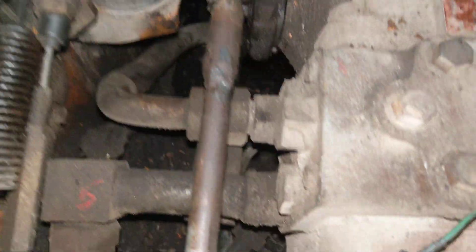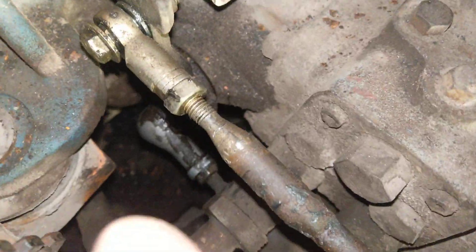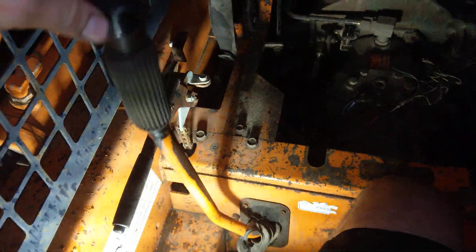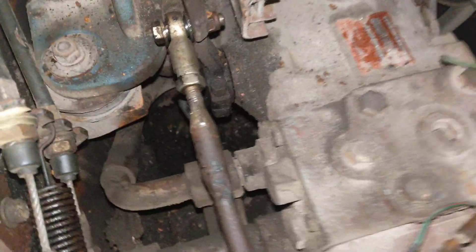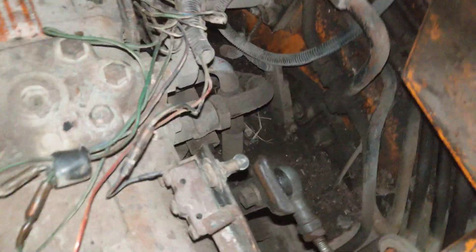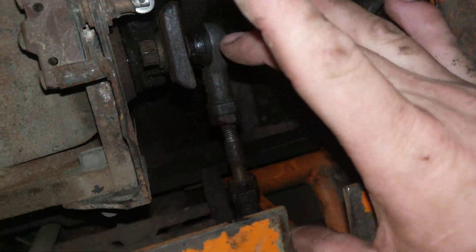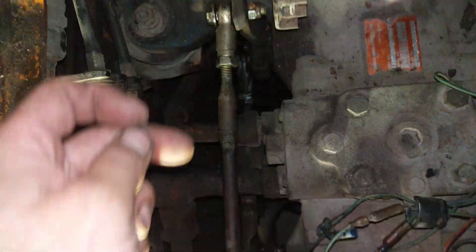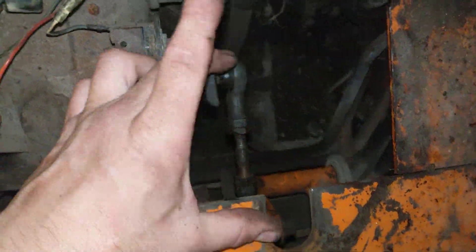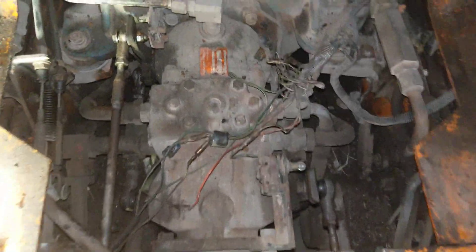When I got this, this part was loose right here, and then the return spring arm on the bottom was just off on the back — that's what allows these to return to center. This one didn't have it, so it was just loose. I took it back up and tightened that down. Per spec, the distance between the center of this and the center of the other one should be 5.4 inches, and this one should be 15 inches — from the center of this joint to the center of the other joint.